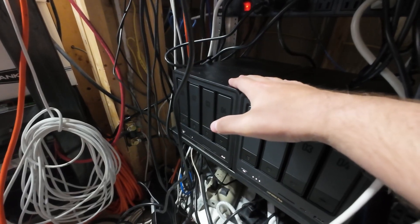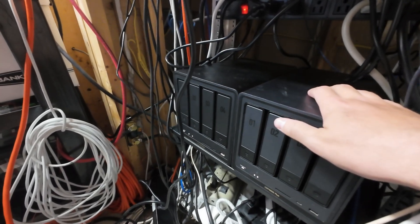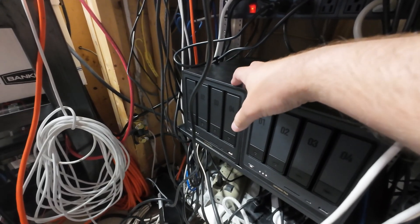I plan to install the additional drives into slots three and four, then change the format from RAID 1 to RAID 5 without losing any data and gain an additional 60 terabytes of space. The other NAS here is one Ugreen sent out to me as a sponsorship — I plan to put four 24 terabyte hard drives in it, giving me 65 terabytes of actual space.